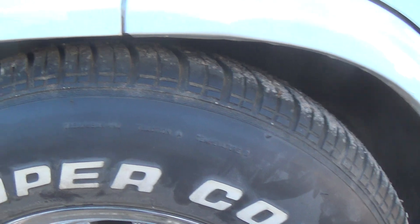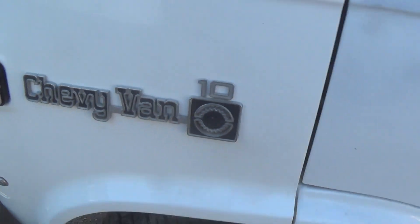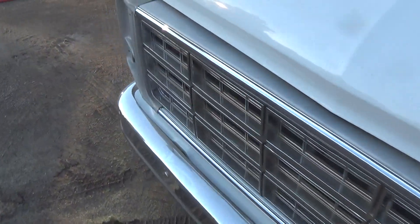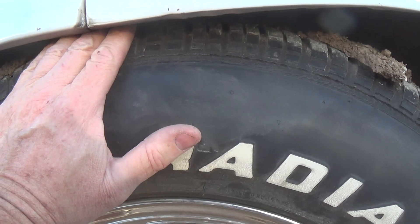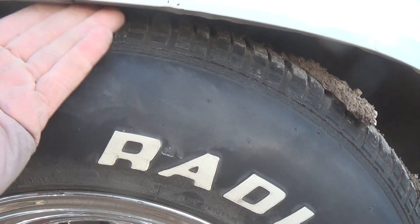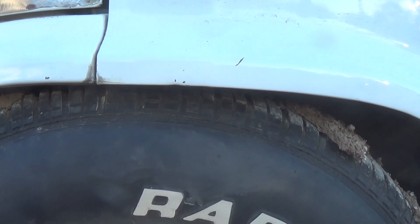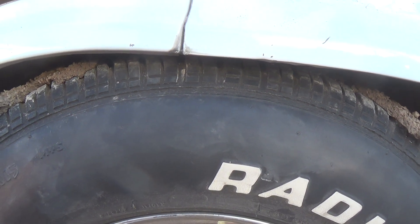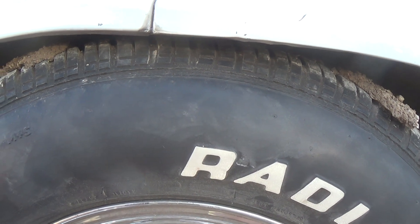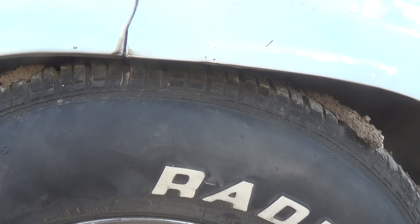On the other side I can get my whole hand in. I'm thinking they must have sold me defective coil springs — it has been known to happen. Looking at level with the top of the tire, this side is perfect, no issues. The low side would rub the fender on a steep driveway — and it already started rubbing. So I've ordered Moog upper and lower control arm bushings and a set of Moog standard-height coil springs to replace these.